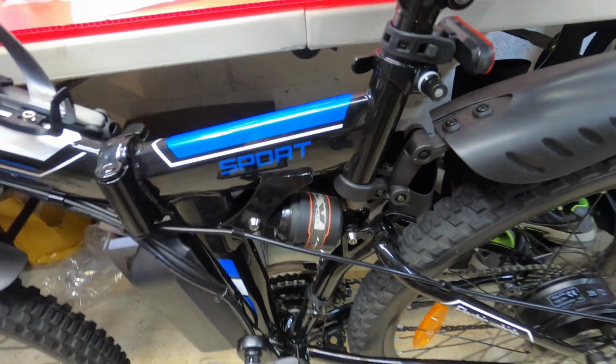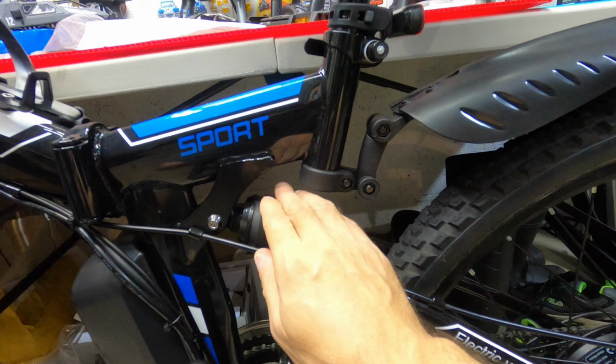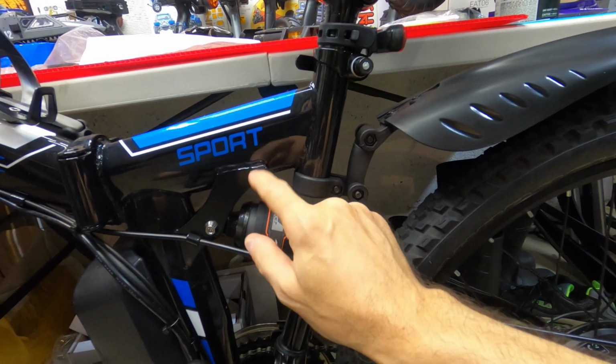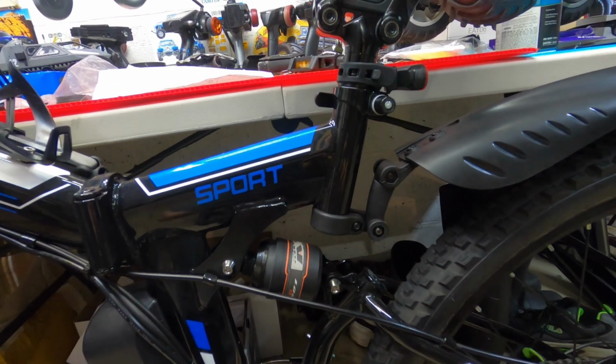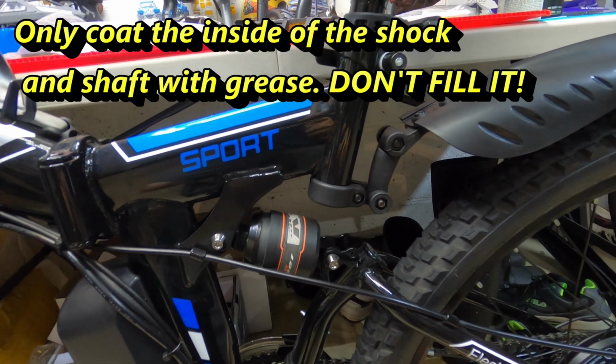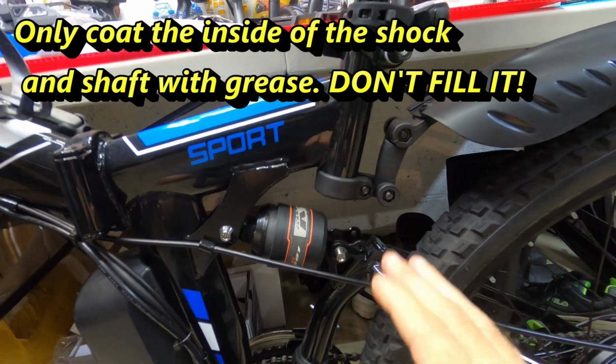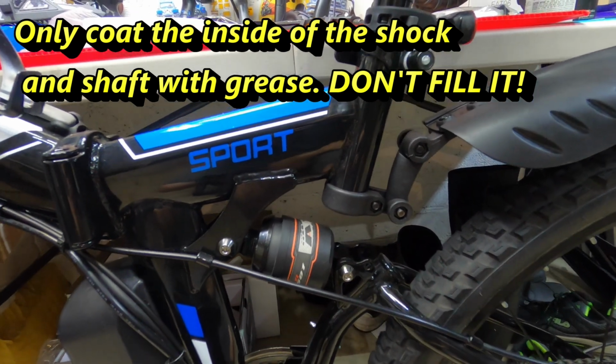It's not much. And another tip on this, guys, unscrew it, take it apart and unscrew everything. There's a big plastic nut, unscrew that and put some heavy tacky grease inside the barrel and on the shaft. Reassemble it and it runs much smoother after you do that.